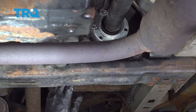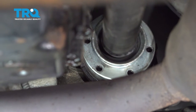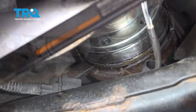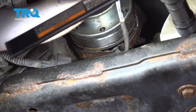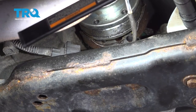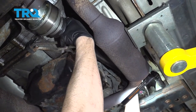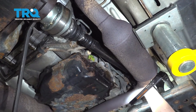We're going to go ahead and use a punch and a hammer. There's a small ridge on the inside of the drive shaft unit here — we're going to tap on that to try and work it out. Go ahead and rotate that. Now we're going to bring it up and try to work the front drive shaft out. I have to use the pry bar on this side as well.